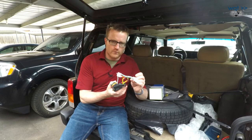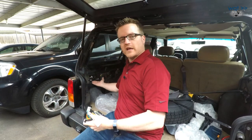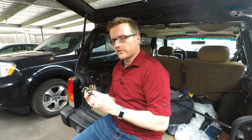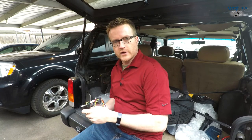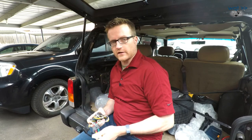This here has an inline wiring harness, and it is supposed to insert cleanly between a couple of the connectors that are back here. And then of course it comes out as a four-flat. I don't need a seven-way on this vehicle. Mostly I intend to use probably a basket, maybe a light trailer now and then, but I do want to have this installed so that it's a little bit easier to connect on the fly.